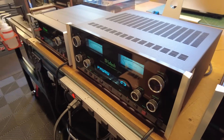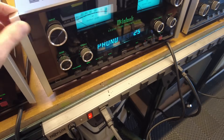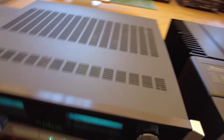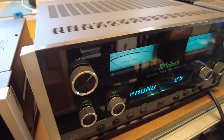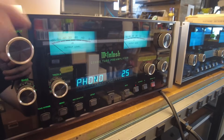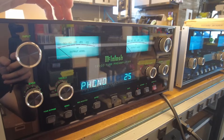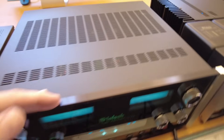This here is a C2200 from Mac. It uses a total of eight vacuum tubes — an all-tube design, also with a phono input. The lighting on these over the years can fade and become distorted in color. We've done extensive servicing on this one, replacing the vacuum fluorescent display, the meters themselves, meter housings, and the filters inside. So this is as close to factory color as you can get on this C2200. It turned out really, really nice.